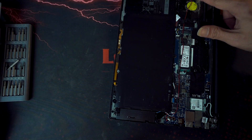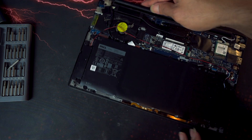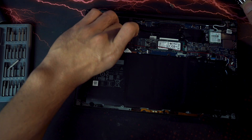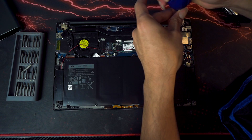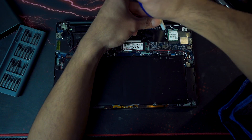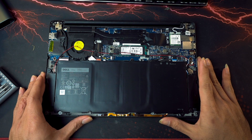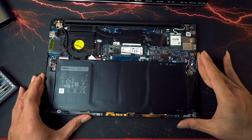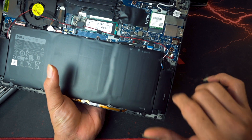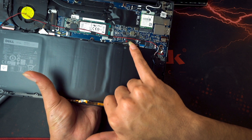That's dirty. So what we're gonna do here, once you have it opened, is you need to remove the CMOS battery and the main battery. This is the battery and this is the CMOS battery here. This is the CMOS connector on this side, and the battery connector is here. You need to be very careful.